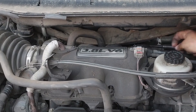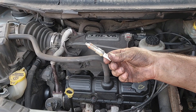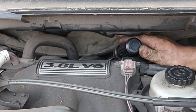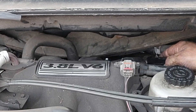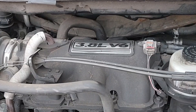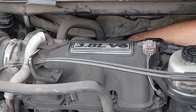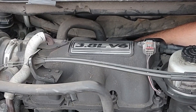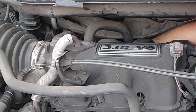Let's go ahead and get this plug out and get the last one in. Got our last plug going in here. Tightening up this last middle one — we just need the six-inch extension and the socket. There we go, that was perfect. The last plug boot has some dielectric grease in there and we're just going to find the end of the plug and push it down until it clicks in. I double-checked all the rest — they're all pushed in and clicked. We're good to go.